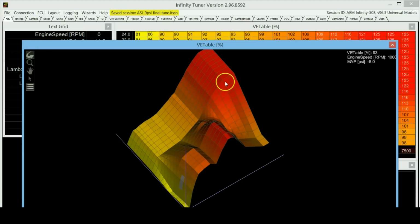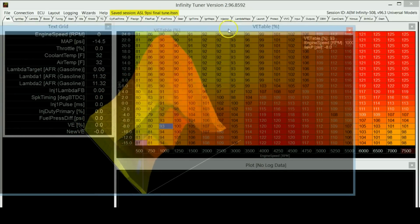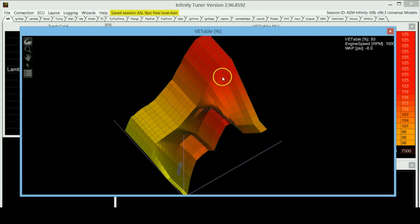But when the turbos kick in, it's actually the complete opposite thing. It becomes more like a racing engine. Now the volumetric efficiency is reaching its max at a really high RPM over here. It is going to come down when the boost level goes up, because this actually has to do with the way the turbos are sized.